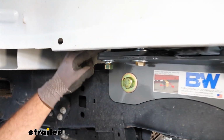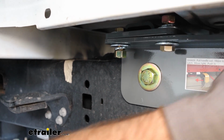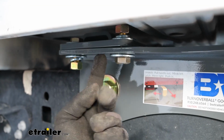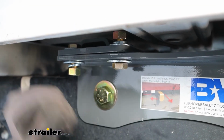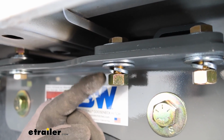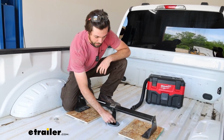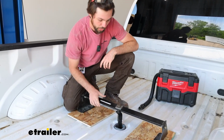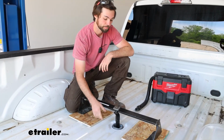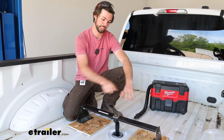You're going to want the bolts head down on all these 3. But this one is going to be the head facing up towards the sky, and then the bolt's going to be on there. And on the top, there's a washer with another washer on the bottom, lock washer, and a nut. We went ahead and we put this device on our gooseneck that's going to lift it all the way flat against the bed without deforming the bed. If you don't have one of these contraptions at home, you could use jack stands maybe with like a strap.